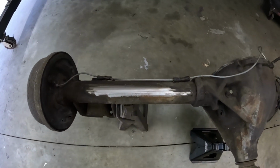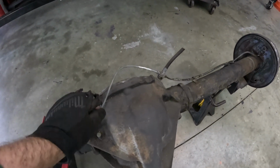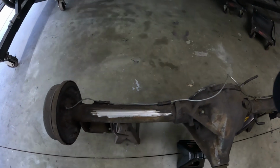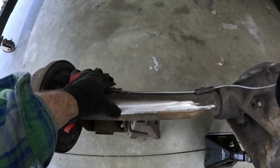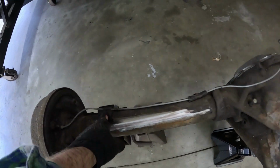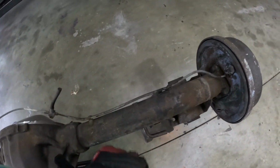While we're over here, this is what not to do with brake lines. This is horrible. This is bad. Does it work? Does it function? Does it get the job done? Yes. But really, fuel line hose for insulation, to protect it from vibrating on the axle, the clips not even bent over. I mean, this is what it should look like, even though I already bent the clips open real quick.